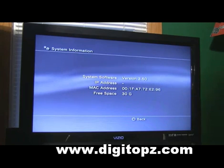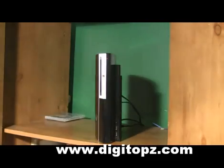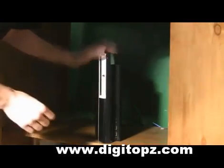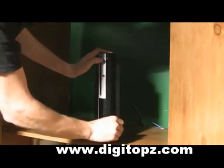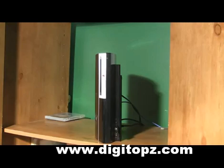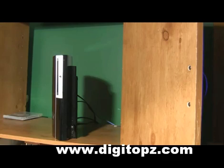Now what we're going to do is the initial jailbreak. Now that you've verified you're in factory service mode, go ahead and turn the PlayStation off again — hold the PS button, go to turn off system, let it shut down. Then grab your USB flash drive and go over to the PlayStation. Important: you want to put your flash drive in the furthest USB port on the right of the PlayStation — always the last one. On this one I only have two USB ports, so it goes in the second one. Start your PlayStation back up like normal and you're going to notice it's going to hang — your TV is either going to sit on a black screen or a blue screen saying no signal. It's going to sit there for probably three or four minutes. What it's doing is installing the 3.41 firmware. You'll notice the light on your USB flash drive will be lit up, and the hard drive access indicator light on the front of your PlayStation will be blinking — that shows it's installing the firmware.